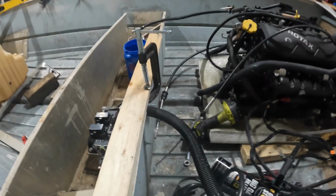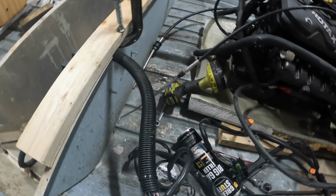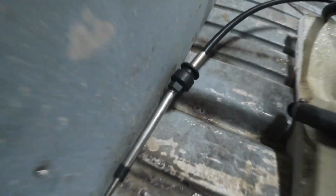And that should pretty much handle the wiring, I think, except for this cable here goes to the starter, which goes up here to the starter solenoid, so I'll either have to punch another hole, or if it's long enough, I might be able to run it right through down here, run it through that big rib, and then just run it up here without punching any more holes.